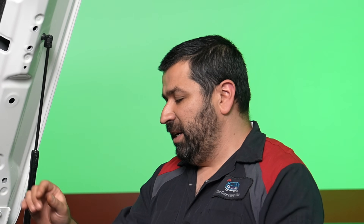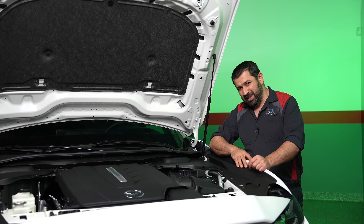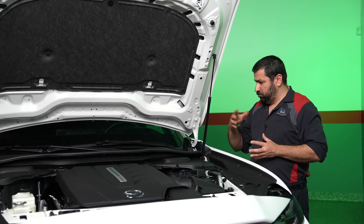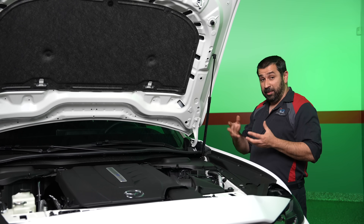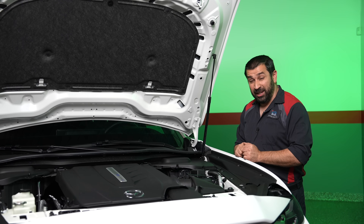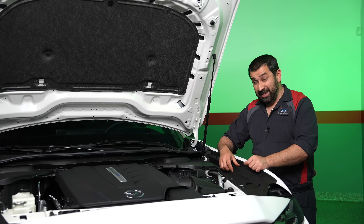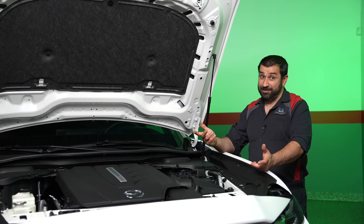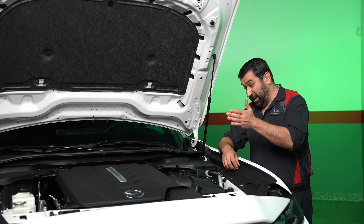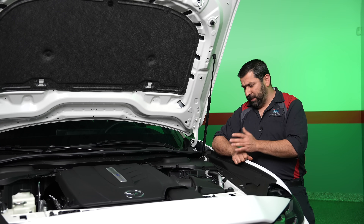The HVAC system in this car is quite simple — same as the CX-90. It doesn't really have a heat pump. They kept it simple: there's an electric compressor so in EV mode you can cool the cabin independently of the engine. To heat the cabin in EV mode, it turns on a coolant heater electrically. In an electric car that would drain range rapidly, but here if the range depletes the engine comes on and it works very well — just a little heater that heats up the coolant and we're good to go.